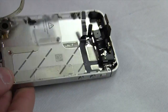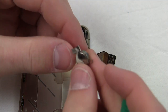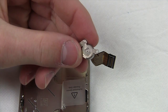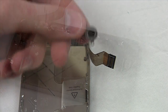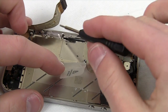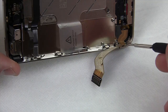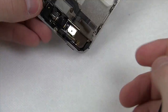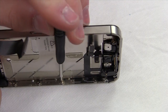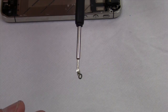The vibrating motor is adhered rather than screwed, and it takes quite a lot of prying to remove. Make sure the adhesive isn't folded over, as that will make it much harder to put back during reassembly. Next is the most time-consuming part: there are 10 screws to remove — three on each side and four in the corners. Many are very tight, so be careful not to strip them. They also have washers, which makes reassembly trickier, but you do need them and must keep track of them.